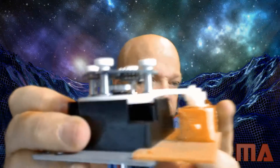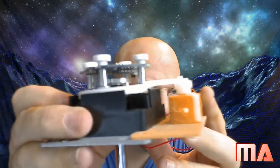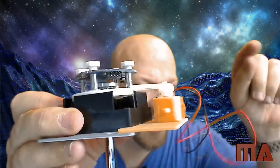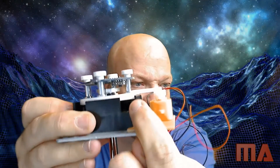As you can see here, I'm just taking it off. The next step is to install the restrictor plate. Basically, you're going to take that plate and lay it on there so that the part that comes up is facing away from the joystick, so you can get over that little black ridge. You can see how the white part goes down into that black area and then up and over, so that it still has clearance.